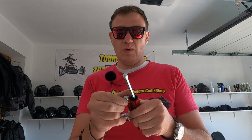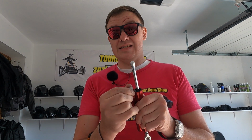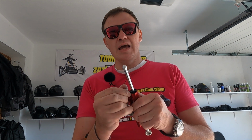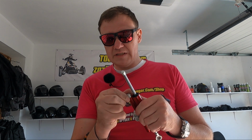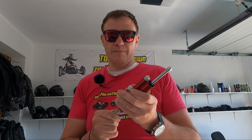Now, the experience is, I'm using position 2, so 2 clicks from the lowest possible position, because that's the minimum YSS recommends. There are many customers using it the same way. I have customers using it between 4 and 6 clicks. The most that they went was 15, as far as I have heard. Nobody goes beyond that because it's just too much. The steering is super stiff and you can barely move the steering wheel.